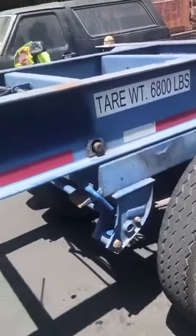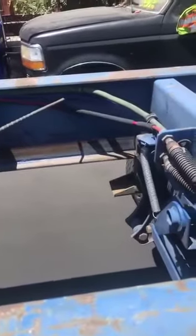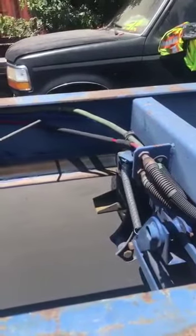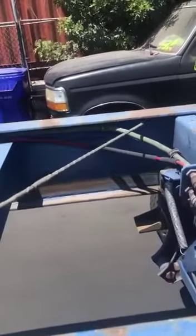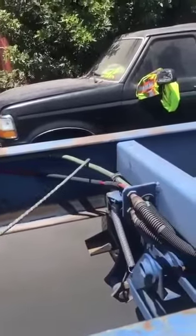Going back to the inside, I'm going to be checking my Airlines. My red is for emergency, my blue is for service, and I also have my electric cable. I'm going to be checking my Airlines for any cuts, cracks, or bulges. I'm making sure it's tight and secure at each end, and I'll be listening for any air leaks. I'll be checking my electric cable, making sure it's tight and secure at each end, and I'll be checking for any bare wires showing that could cause a short.